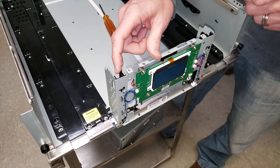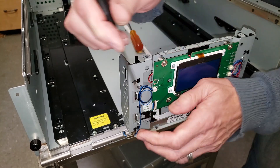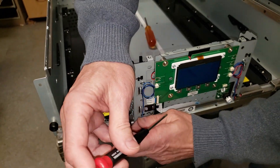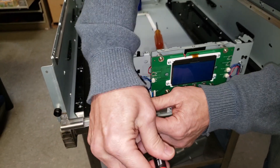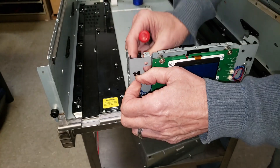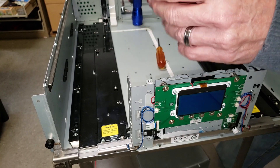If this particular rail is bad, there are three screws that hold it in from the front — one, two, and three. This little wire harness assembly gets in the way a little bit, but to pull it out you just pull the screws out: one, two, and three. Then you just slide the rail toward the middle on these two pegs and it comes out of the slot, and you have it out.